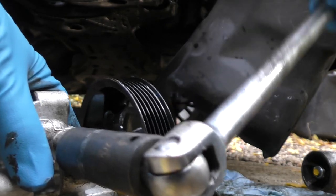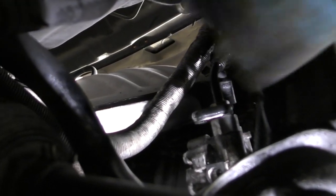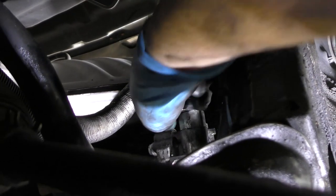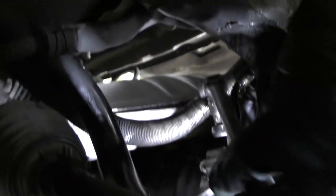Get the switch super tight, then bolt the pump on. There's no working room to see, so you've got to do it blind. Get the high pressure line and stick the crow's foot on it, then spin it around until you get it snug. Put the wrench on it to tighten it finally — you need it super tight. Not much working room; it's a dirty greasy job. You want that fitting super tight — you don't want that sucker leaking.